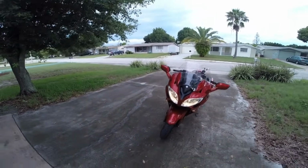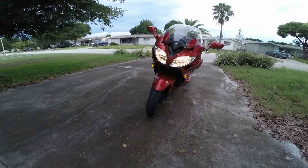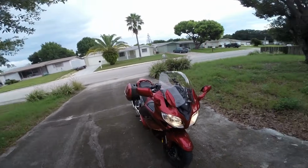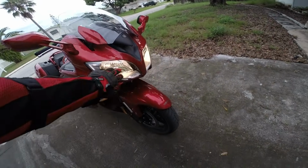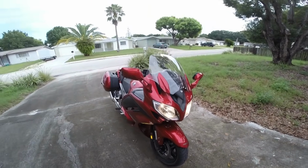I guess I'll show you the headlights here. Standard headlights. All right, nothing special about the bulbs. There are HID kits that you can install. They may not be legal in your state because these reflectors are not designed for them, and with HIDs it's very important they're aimed properly so they don't blind oncoming drivers.